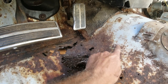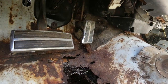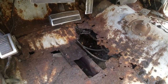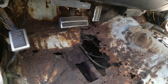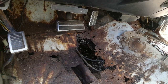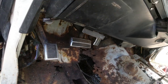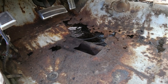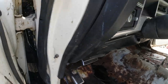What we're going to do is just cut along the edge and replace what's needed. Like I said in the other video, nobody makes new parts for this car — they don't make new floors or quarter panels or anything. Luckily I have a parts car, and that's what we're going to do — cut them out of the parts car. Although it's a four-door, it should be the same, but if not we're going to make it work.